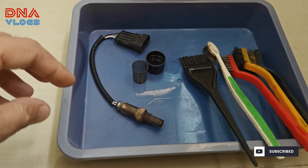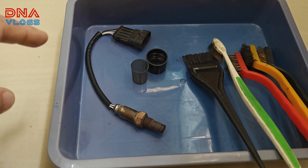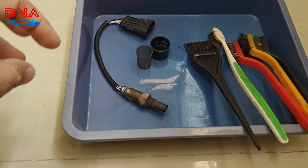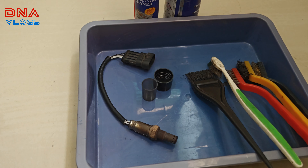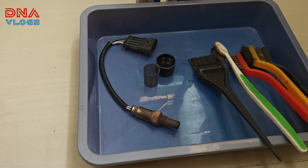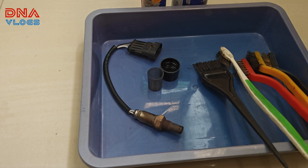The issue is very prominent at around 3000 RPM and at 6000-6500 RPM — it feels like the accelerator is turning off or something. It does not misfire with loud exhaust shots, but I feel the roughness in the engine.